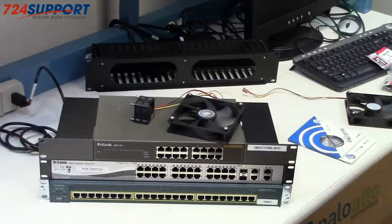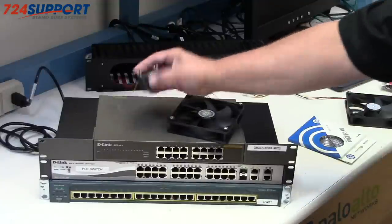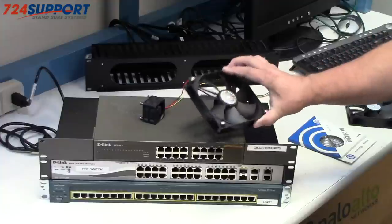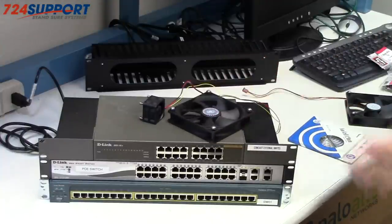Once you've taken all your 1U servers and converted them to either VMs in a quiet 4U box as we've described, or have taken the ones that need to be independent and put them in a passive or quietly cooled 1U box like the Supermicro Atom servers, what remains making noises is the switch. The switch gear typically makes a lot of noise because it has a whole bunch of fans like this instead of fans like this. So as we saw before, they can be quite loud.